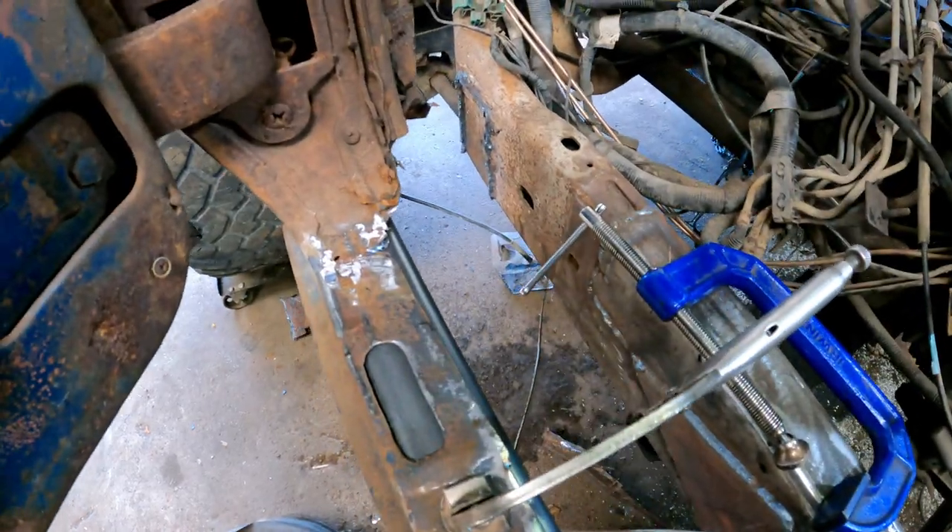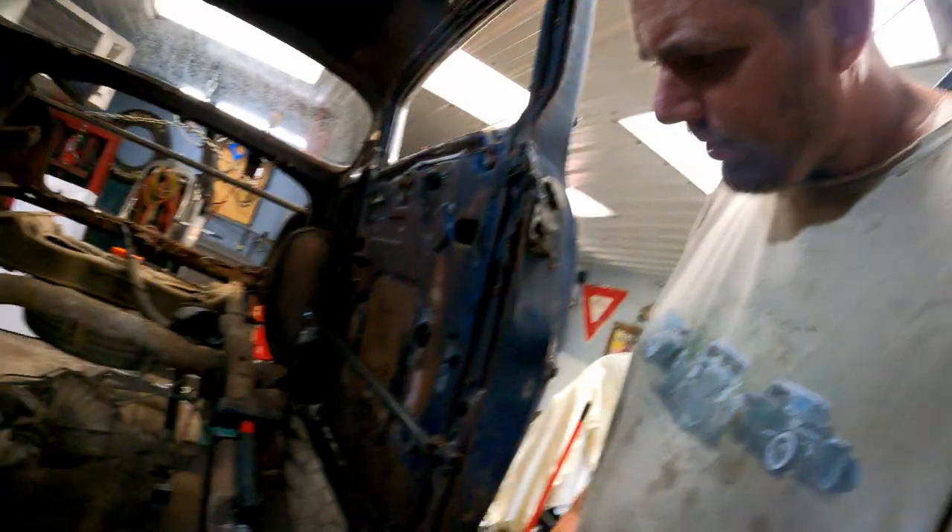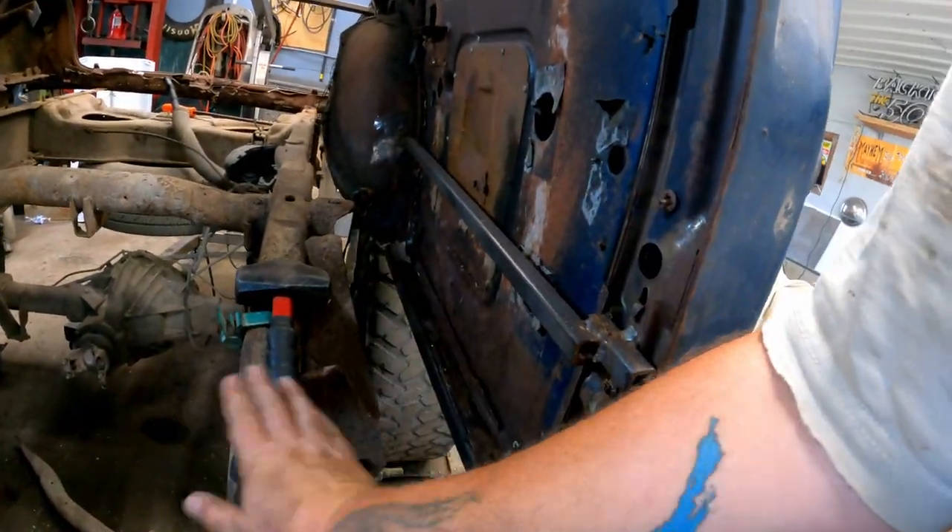Here's what I got cooking. It's probably not the best way to do this — somebody smarter than me probably has a way better way — but I'm using what I got and just doing it. I got that one-by-two in here, got it clamped under this rocker so I can get it welded on the outside edge and on the inside. That lets me rebuild it all the way back to that wheel well. It should be okay once I get the floor structure in there — all the body is going to be putting pressure down on new metal. I'll do the same thing on the other side, and that'll be the start of my framework for the floor and attaching everything. I think it's going to work.